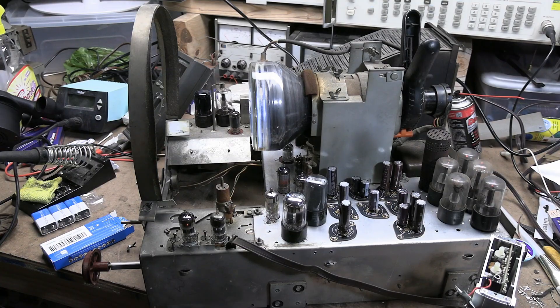This is a TV I'm currently working on. It's at the point where I can get something through the tuner, so I know it's working well enough to give this a try. If I don't get anything, the first thing will be to try adjusting one of those trimmer caps.